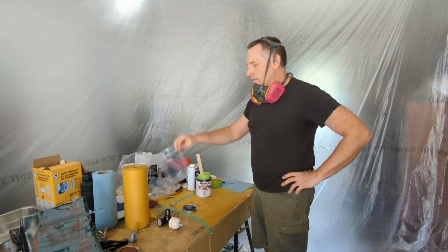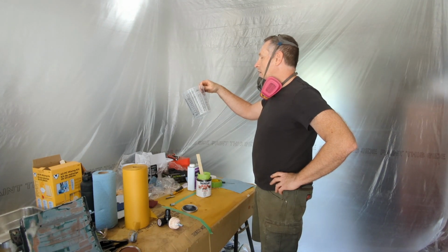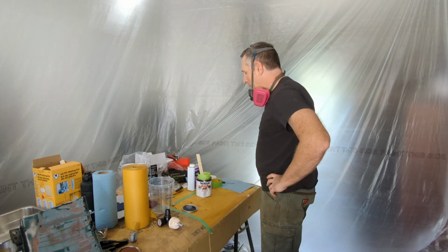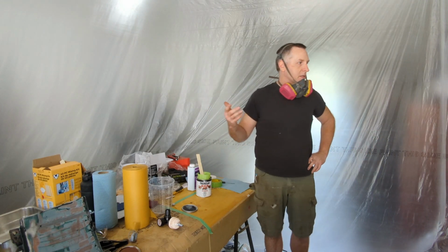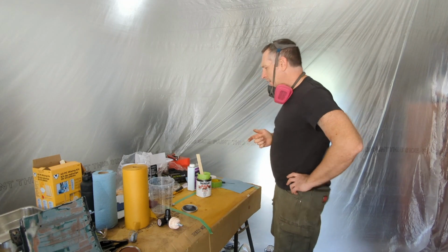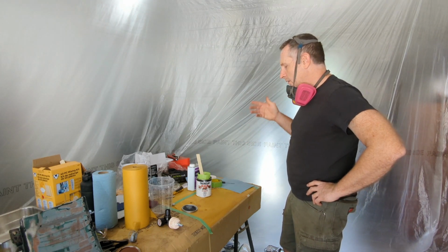I don't have a 4-3 on my mixing thing, so I think I'm just going to go 2-1. Now I'll go 3-1. We'll see how that looks, and I can always add more if I don't like it. I'm going to use the whole quart. I'm just going to mix it all. I went through it pretty quick yesterday. Found out that I had my gun not quite set up right. So yeah, I've learned a lot since yesterday. My pressure was wrong too, so that was good.